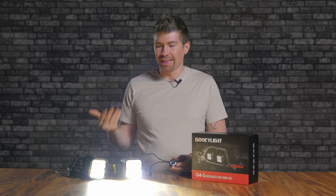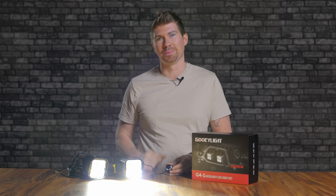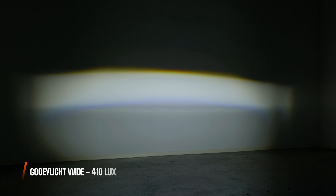I'm going to show you what the light output looks like on the wall, then compare it to an off-road pod light that we sell and have tested extensively. When you turn the light output all the way to yellow, I measured 270 maximum lux. When you turn it all the way to white, I measured 410 maximum lux. Converting from white to yellow typically loses about 30% brightness, so that's pretty on point. If you turn the dial to the center — half yellow, half white — I measured 580 maximum lux.